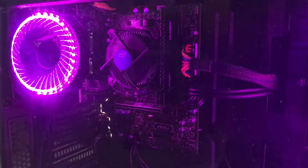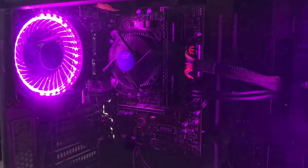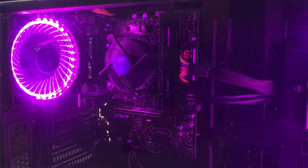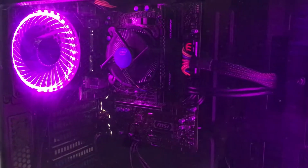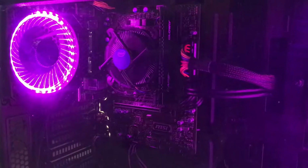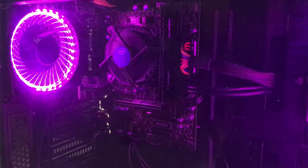This is on the PWM fan curve, of course. And actually no, it's PWM control on a silent fan curve that I set myself, using the BIOS, which of course you can tweak yourself also, depending on how fast you want them running. So right now I have them on a very low speed because our computer is at idle. And I also did another test where I ramped up an AIDA64 stress test, and the only extra noise is from the CPU cooler, pretty much.